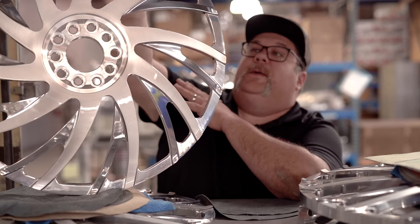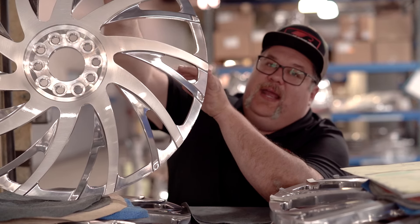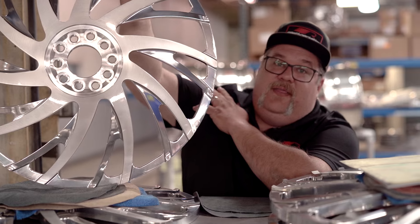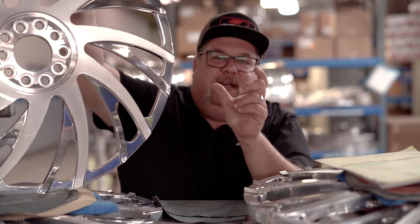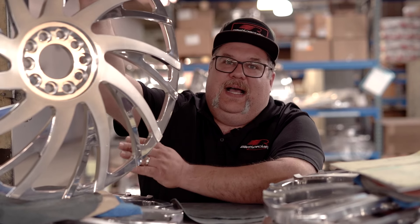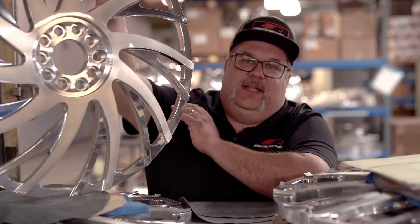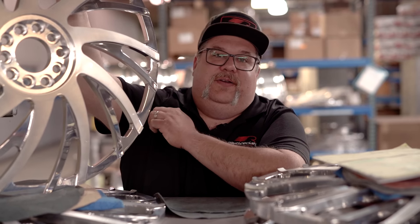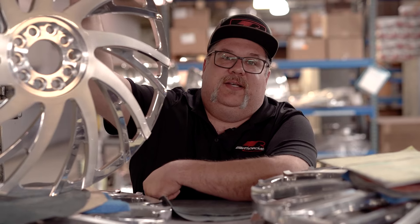This is a reverse center — it's going to be slightly smaller in diameter to mount on a specific area of the rim called the drop center, which is what helps you get your tire on. That gives you that giant lip with that little offset in the back to narrow your rear end and get that look everyone wants. We're doing a 26 by 10 reverse. We're also going to build a 26 by 10 with a standard back spacing to show you the difference — the reverse lip requires modification to your rear end, so you can't bolt it up stock. I'll hand it over to Horacio, my assembler, who is a certified tech doing all the welding and aligning.